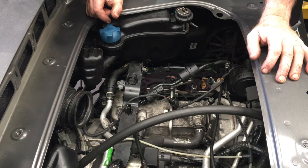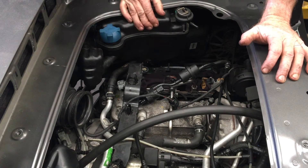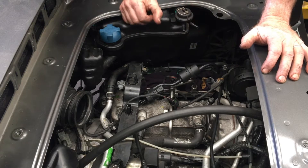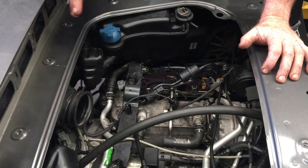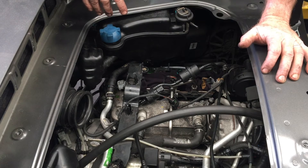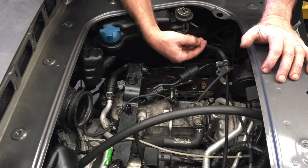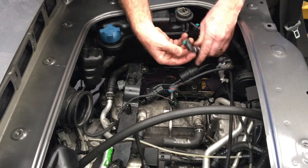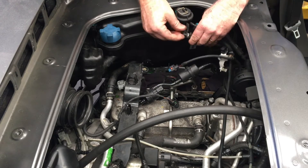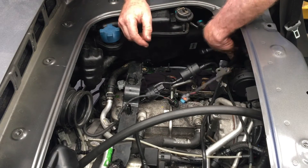Once you've done that, we can remove the intake manifold, because the tank won't come out with the left hand pipes in place. You'll need to remove the resonance tube in the middle and then the pipes on the left hand side — have a look at the link in the description for that video. Then it's a relatively simple process of removing the tank. The two connection points here should already have been disconnected, but if not, that one is just a single press to pull off, and this one is a double press — one on each side to remove it. You can smooth those out of the way.